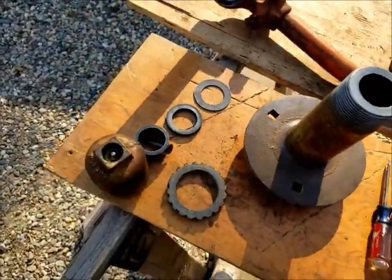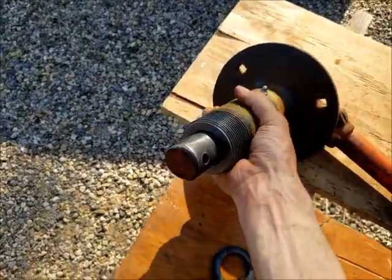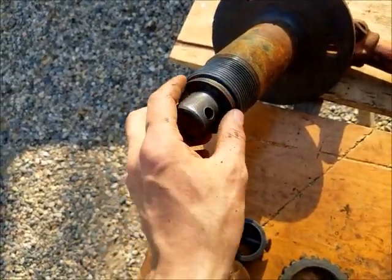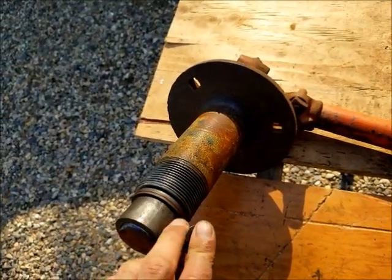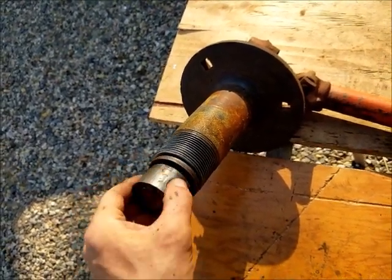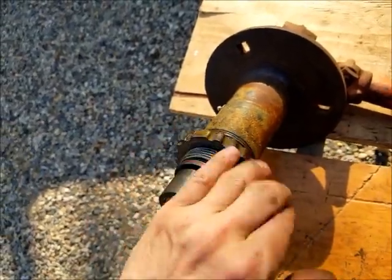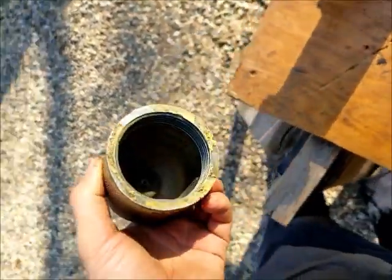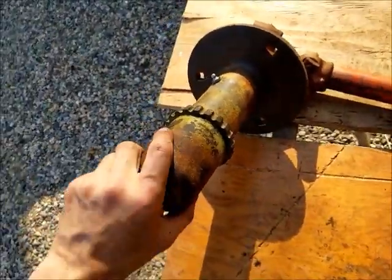Got all the parts cleaned up — washer, spindle, and there's a stack of thrust washers, then there's what I'd call a lock ring and a pin that goes through that to hold it in place. Then there's a big lock jam nut that goes on there. Cleaned up the cap — there's a grease fitting in the end of the cap that was out — and cleaned up the inside of that cap nice.